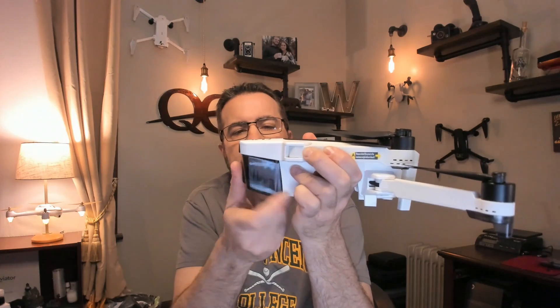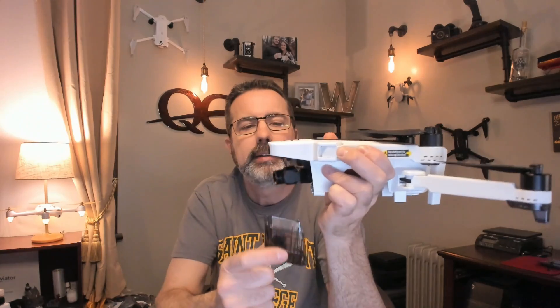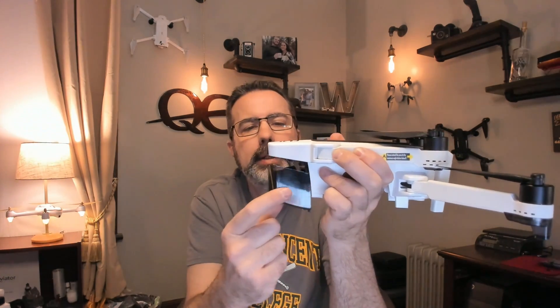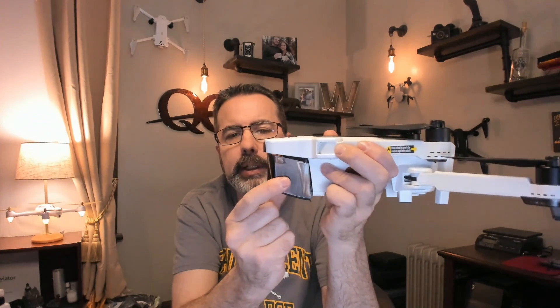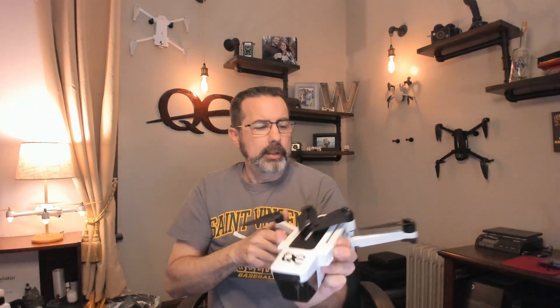Very easy as long as you come up straight. If you come in at an angle you're going to fight it and fight it and might also damage it if you try to force it. It's better to look at it from the side so you can see the indentions you need to catch. Once you're at that point, get the front end in, snap the back — real simple. That was it: how to do the removal of the camera gimbal, replace the ribbon cable, put it all back together, and hopefully you have FPV. That ribbon cable is something you should order and keep aside — put it in your arsenal of must-haves for the Zino 2, because chances are one day you're going to need it. Thank you everybody for watching — subscribe if you're new, hit the bell for future content, and thumbs up on the way out. Talk to you on the next video, take care.